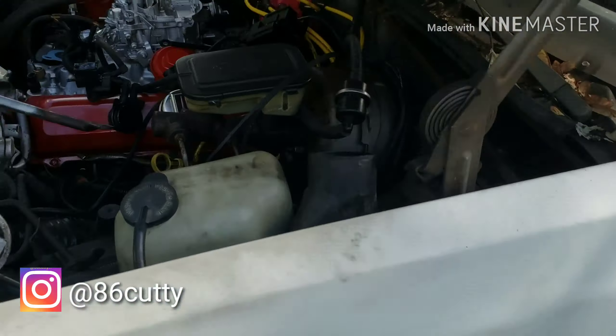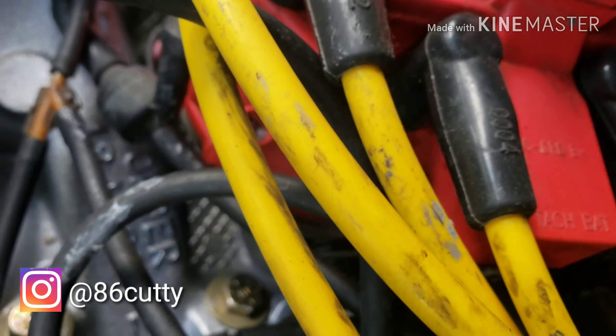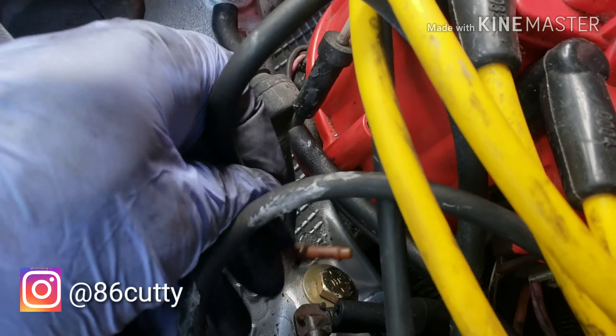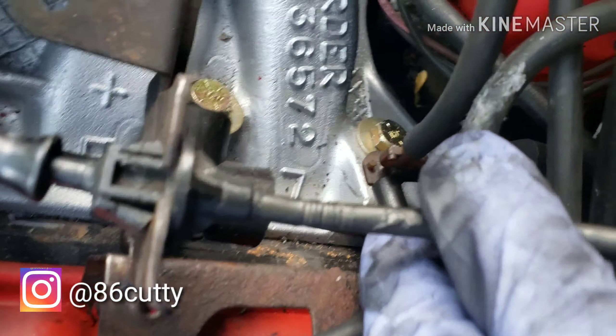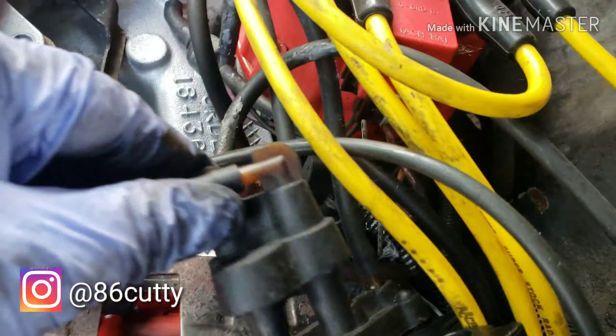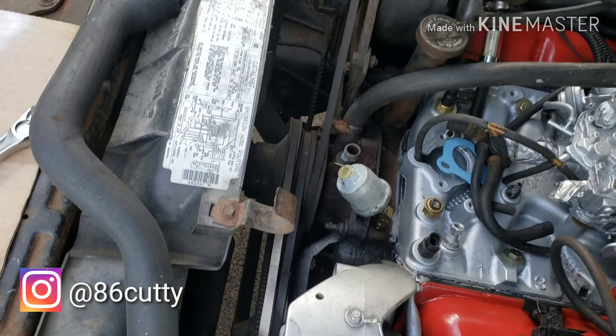This is going to help me out a lot because I didn't take a lot of pictures. So let me just go and finish working and take my time to figure it out. This is why that diagram is important — I'm glad it's still on the car. Because if you can see it, the line in the bottom goes down. That T fitting swings all around to that first port on that carburetor. That vacuum diagram in front of the car is what just saved me with routing that. Everything is almost done on this side, and that diagram saved me.